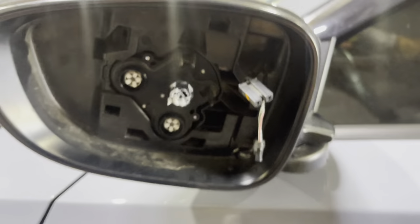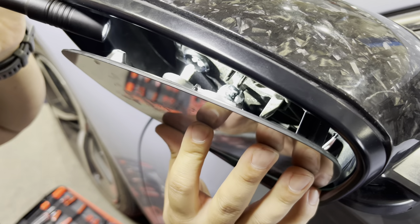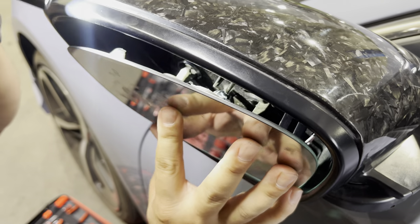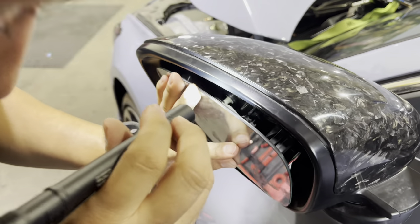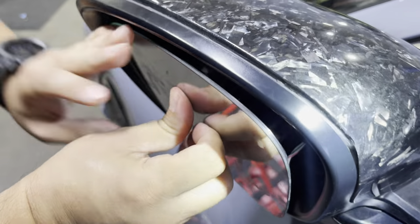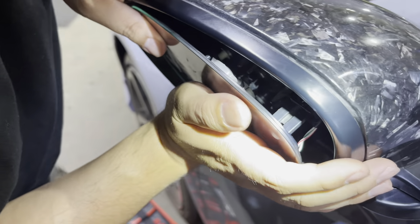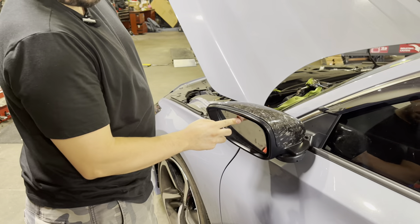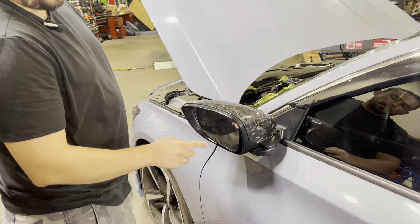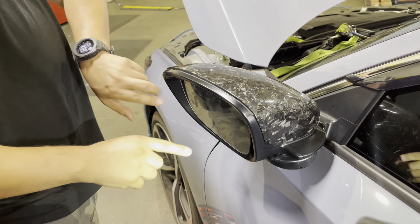I'll try and show you guys when I do it right now. After I plug it in, I'll show you guys how I snap it. So this is where I usually put pressure right here in the middle, since that's like the biggest support spot on the back of the mirror — I don't want to risk cracking it. The teeth — you've got to see how that one needs to line into that hole before you push, and then the bottom one also. Those need to line up before you push. I'm going to get towards the center of the mirror once I feel like both of those are lined into their holes, and push in place. Usually when the thread is locked in, you'll hear it going both ways. If you could hear that noise going up and down and side to side, then you know both of those are locked in place.